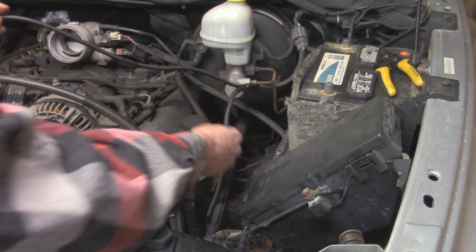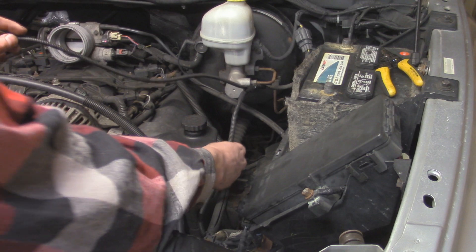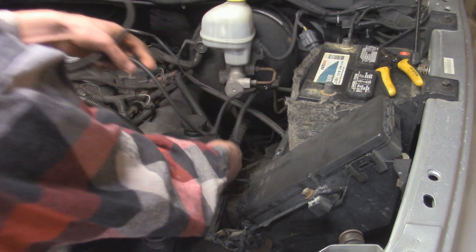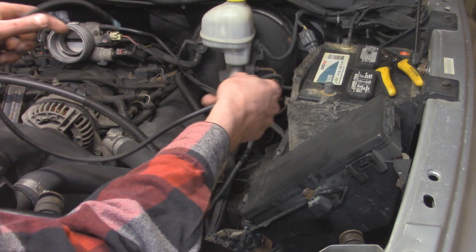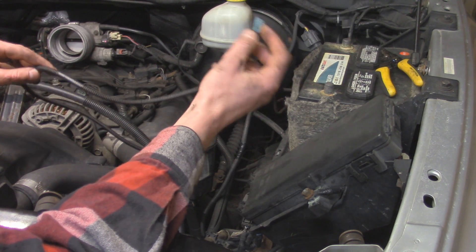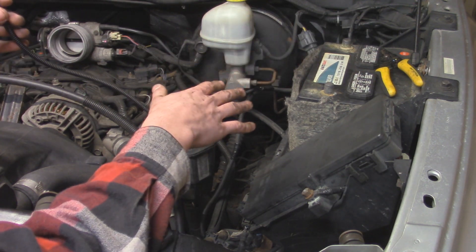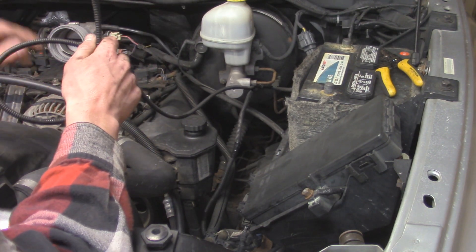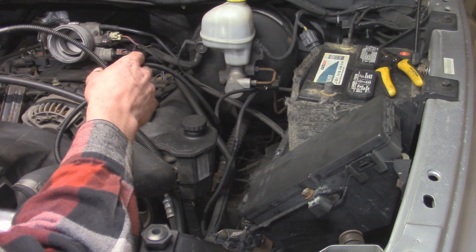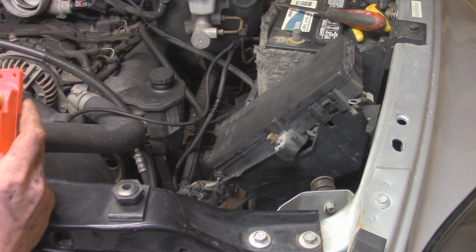Off camera I made a separate wire loom for the small wires that shared the loom with the cables. I used a quarter inch extension from the main plug, with the four four-wheel-drive wires going to the front axle, and some eighth inch loom for the wire that goes down to the starter. I also put a new spade connector on there since the old one looked corroded. When installing the new cables I'm not going to put wire loom on them — as long as nothing is rubbing or chafing it should be fine. We'll just zip tie everything out of the way so it stays firmly in place.